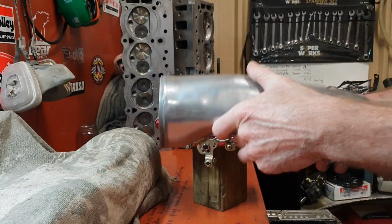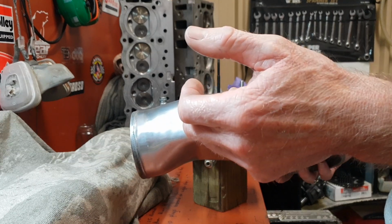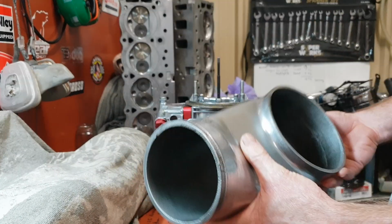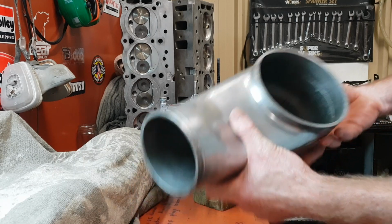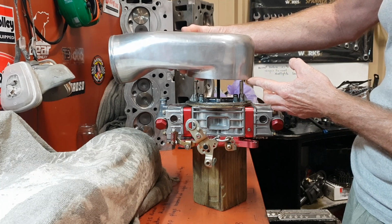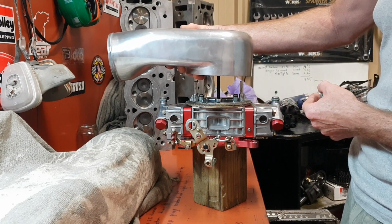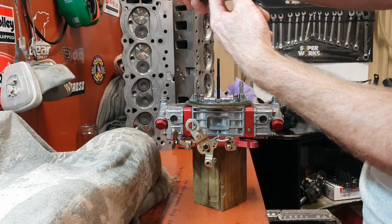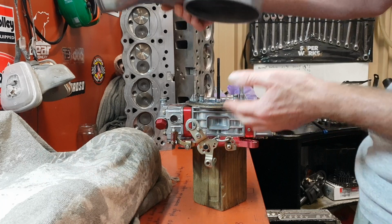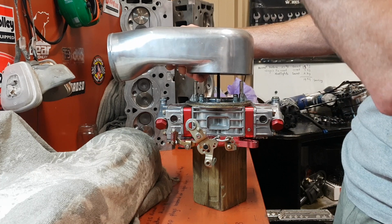It's not even a blow-through carb hat, to be honest. They only sell them as a cold air intake, but I've seen them on YouTube. A lot of people do run them, so whether or not they've had issues with them, who knows? But I've got a mega issue with it. So Jez recommended I put a bit of a plenum on it. Now what it's going to do, if we lift that up, say, a minimum 2 inches, all of a sudden we've got away from this horrible bit of turbulent crap in here, and we're starting to get a nice bit of flow because we've got away from this horrible corner and given the air a chance to straighten up and shoot down.